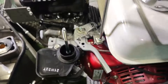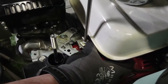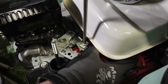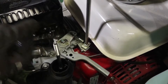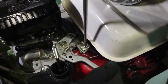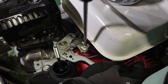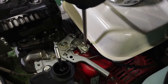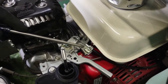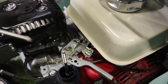I've got a number two Phillips and I'm just going to loosen that here. Once you're down here, you can adjust it out — the farther you go in this way, the lower the RPM is going to go, and the farther you pull it to the right-hand side, the higher the RPM is going to go. Get it where you want it. I normally like to go a little below 3450, because this will raise the RPM by a lot.